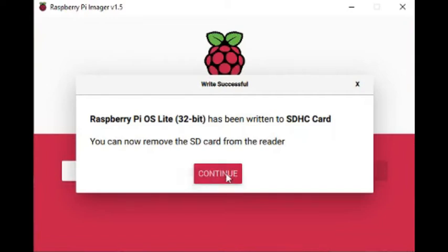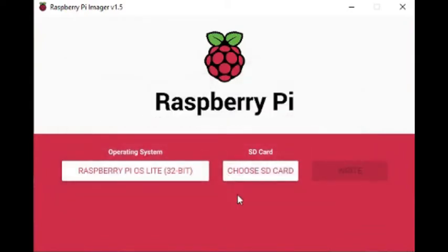And we can continue. Now, one other disclaimer I should add here is that a downside to the approach that Open Media Vault have taken for this latest version is that you cannot set up the Raspberry Pi from the network, allegedly anyway, partly because it has to be restarted again and again. So I can't set this up in the way that I set up Samba. I have to use a monitor and keyboard. So I'll set up a rig for that, set up a video camera, and so on, and we will continue from there.